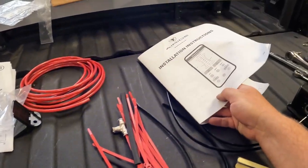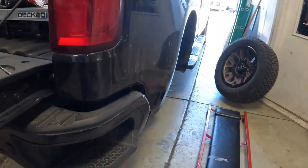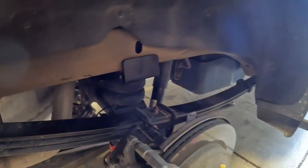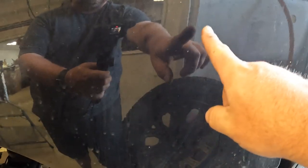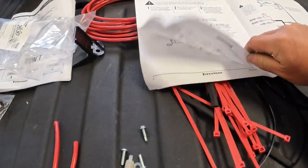Here's what we got. We do the air compressor next, which is what this is. We have the air springs or airbags installed — all tightened down. There's a bolt on the bottom, tightened down, all bolts in there, nice and snug. Now we're going to put the air compressor in. We have a spot that is a body cavity in here. The plan is to put the air compressor underneath and bolt it to the other side of the bed, then put the ECU unit over here. We can do our quick access to our electrical lines all the way down. To do that, we have a little template.